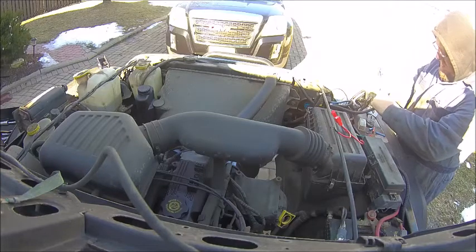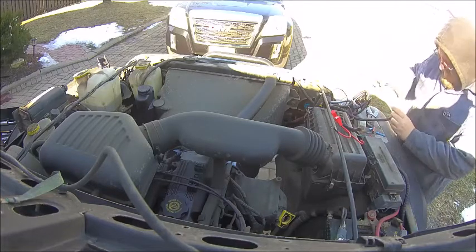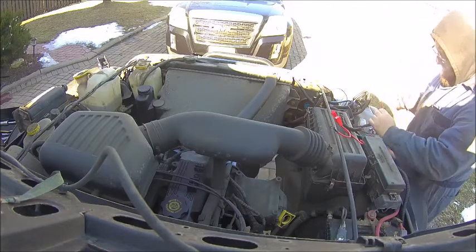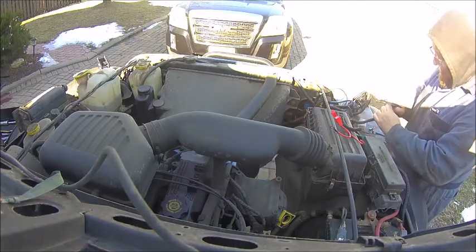One of the nice things, because it is the ceramic connectors, is that I could upgrade my bulbs down the road to H4 using the existing harness and not have to worry about the harness melting or overheating.